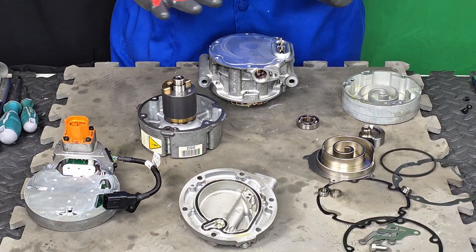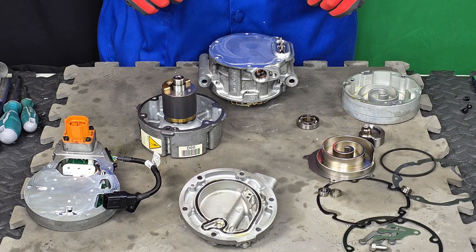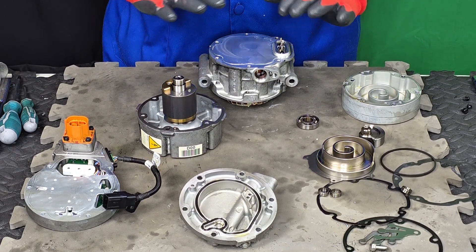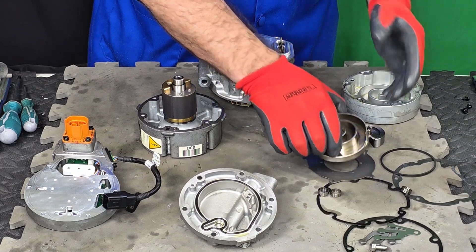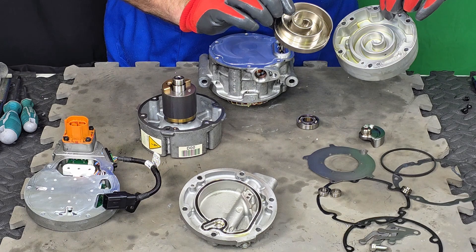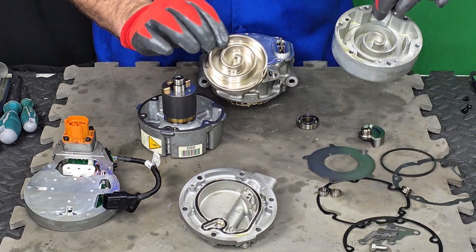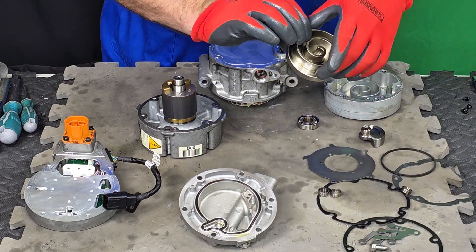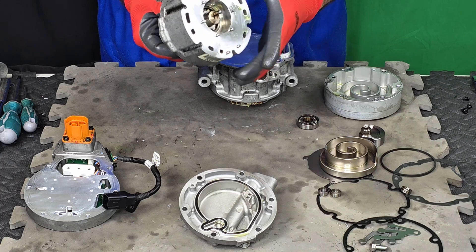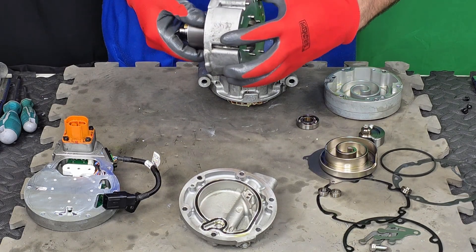Welcome to this new episode where we finally diagnose the air conditioning compressor of this 2017 Hyundai Ioniq Hybrid. The compressor, as I mentioned in the previous video, was working properly — no problems, as we realized in the scroll piston and scroll cylinder. We don't have absolutely no scratch, no metal debris. We finally found out that the problem was the central bearing, which unfortunately is a very common issue, very similar to Nissan e-powered cars.